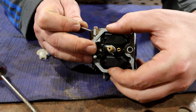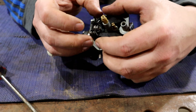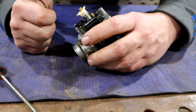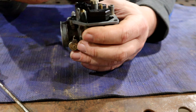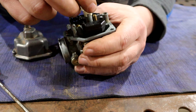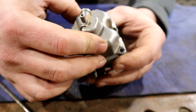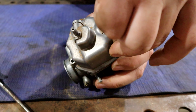Are you a member? It only costs a dollar. The only shit part about this garage — YouTube — is that they don't listen to EDM. Where does this go? Oh, that goes the other way — we're doing it wrong. Big time doing it wrong. Hey, it fits so much better when you do it that way. Alright, so we're all back to the end. We've got the pin in, we've got our jets all in and tight, we've got our bowl. We're going to drop that bad boy over and then three screws back on. That's it — taking apart the carb, cleaning it, and putting it back together.